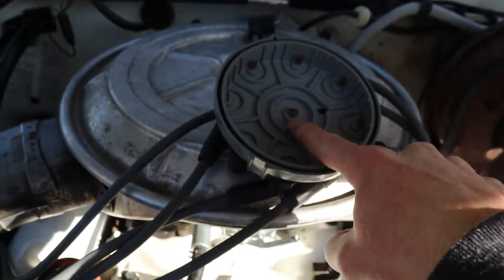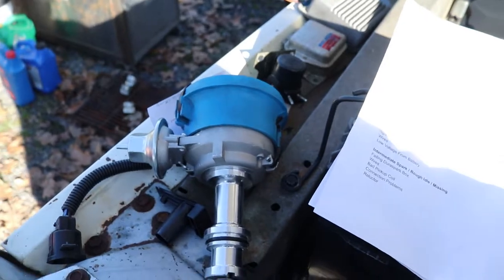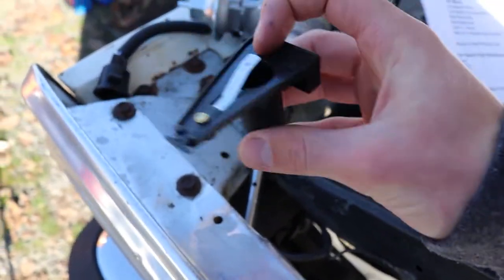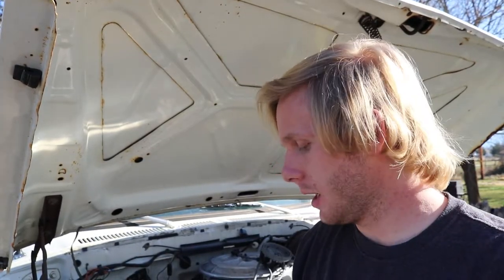Another weak spark cause: these caps can get loose, rotating back and forth, and the inside can be worn out and loose on that shaft. The rotor can also have a corroded connection or wrong spacing — make sure you have the right rotor for your vehicle. Spark plug gap is also a pretty big deal for weak spark. If the plug gap is too small it gives symptoms of weak spark because there's not enough of an air gap for the spark to jump across. On this vehicle I believe it's 0.043 to 0.046 — I have mine at 0.044. Use a spark plug gapping tool.